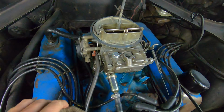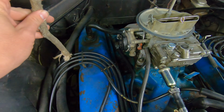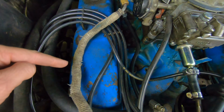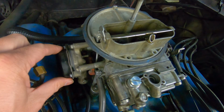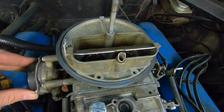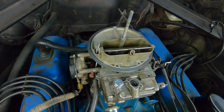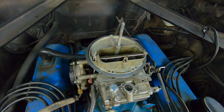So if you're unfamiliar with how a hot air choke works, this metal tube goes down. There's a little port on the exhaust manifold that it will insert into. And all it does is it transfers heat up through the tube to the choke thermostat, okay? And it'll heat this up, and the choke will open as it warms. We want to get that working. That is a vital component to cold starts, especially here in the winter in Utah. These carburetor engines are pretty cold-blooded, so we want the choke to be working perfectly.